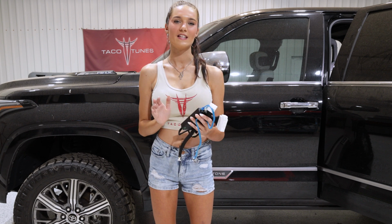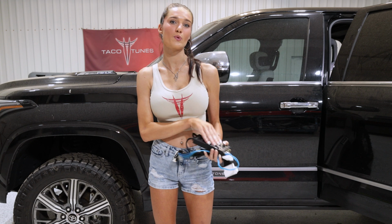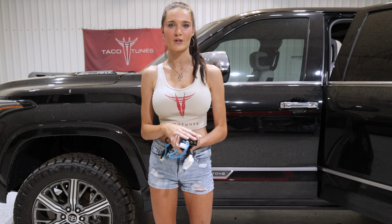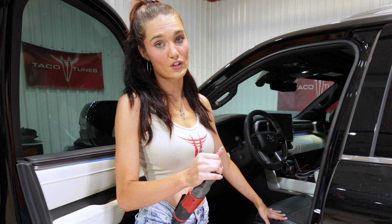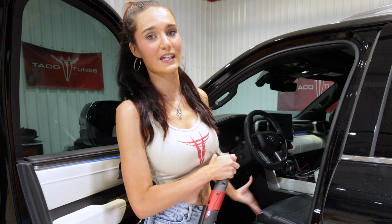Hi, my name is Kayleigh, and in this video I'm going to show you how to install our Add a Subwoofer harness package in your 2022 and up JBL equipped Toyota Tundra. The JBL amp is underneath your driver's seat, so I'm going to go ahead and use my Torx bit and remove all 4 bolts and lean my seat back.